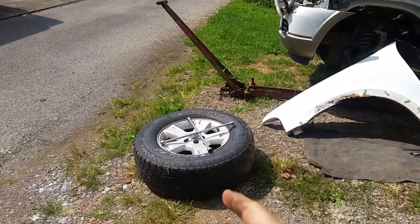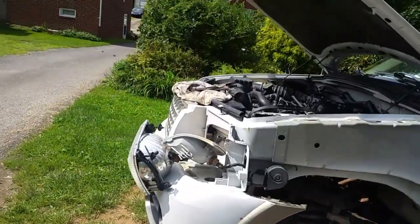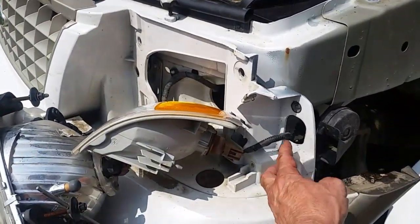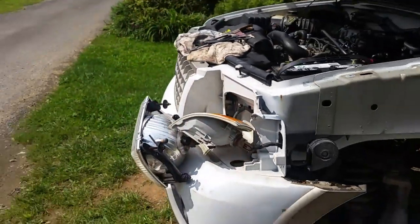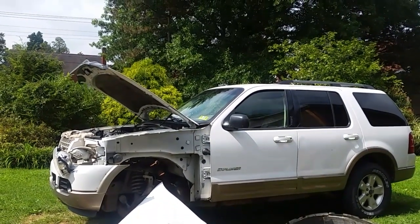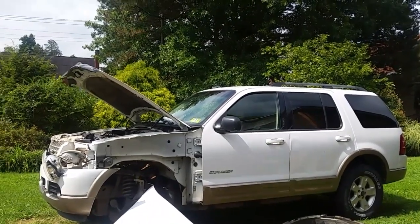Just remember: you don't have to take the wheel off, but it does make it easier to get in here and work around. Make sure you get these bolts out on the bottom that hold the plastic cover in, and the two back here behind the hidden parking light and turn signal light. Trust me, it will make your life a lot easier. If you like any of my videos, please subscribe, say hello, let me know where you're watching from. If you have any questions I'll try to answer them. Thanks for watching folks, and I will see you later.